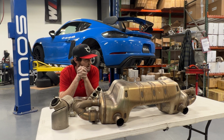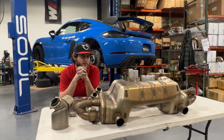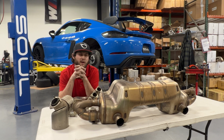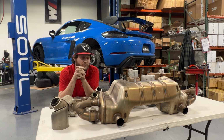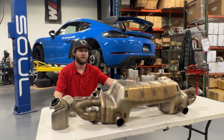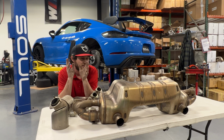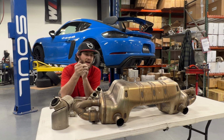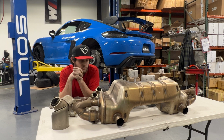That means that the muffler, more so on this car, has become a bit of a cork on the performance potential of the 4RS using the 992 GT3, where our experience in terms of exhaust development has been a primary flow path of 3 inches has been optimal in terms of getting the most out of that engine. So we've got some pretty big plans in regards to header replacements, over axle pipes to get rid of the particulate filters, and a muffler replacement, valved and non-valved, not just to get more sound level and a different character and tone for those people with those goals, but also to maximize the performance potential out of the muffler on this car, which now seems to be more restricted.